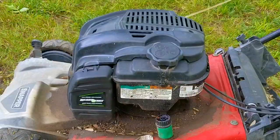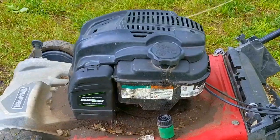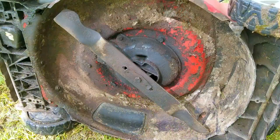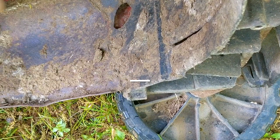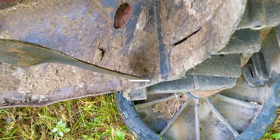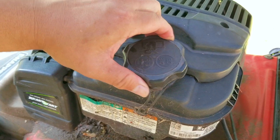It was hard to miss, but this mower was shaking quite a bit, which is concerning. Running over hard objects with your mower can severely damage the blade, or bend it and cause it to vibrate while running. To see if the blade is severely bent, I'm going to check to see if both sides of the blade are close to the same plane. By using the mark on the screen as a reference point, I'll rotate the other end of the blade to the mark and see how far off it is. The surprising part is that the other end of the blade is very close to the same mark, which means more than likely the blade is not bent. This test is not very scientific, so I'm not going to take its results as final, but it is a good visual tool.